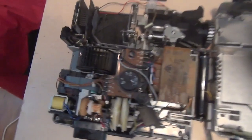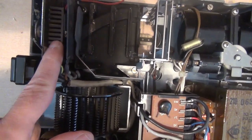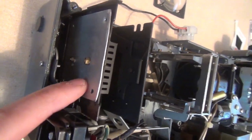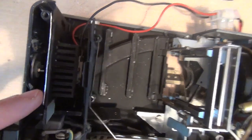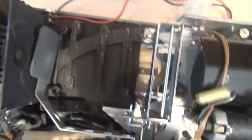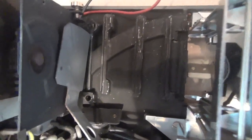I've taken the two halves apart so you can now see the area where the lamp is. This is the heat sink — I made an aluminium plate to fit that to, and that aluminium plate is fitted to the metal piece that used to hold the reflector, which of course we no longer need. If I lift up this shutter here, you can just see the chip inside there — the LED chip. These slots are for holding the condensers, so there are condenser lenses in there, and you have to remember which way they were in and take them out before you take the machine apart, or they'll fall out.